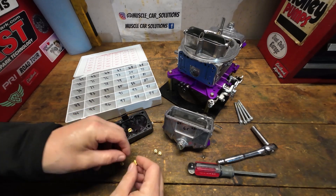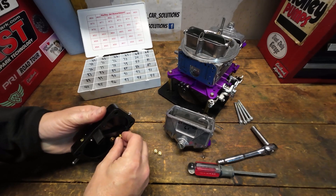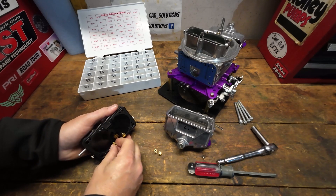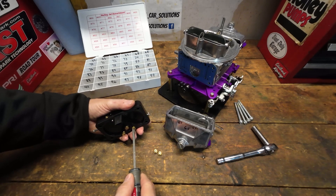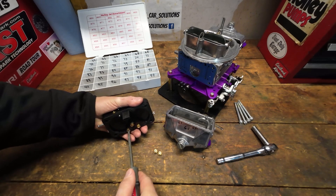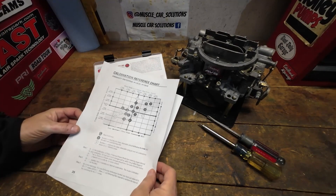You have to consider everything downstream — what's it doing to the spark plugs, what's it doing to the oil? Fuel and oil are not compatible; fuel will destroy the additive package in oil very quickly. You've got to make sure you're not running too rich, especially in an environment where you're not changing oil frequently. Now, if it's a drag car and you're running rich intentionally — on a staged nitrous system, or naturally aspirated just making sure you don't run out of fuel at the top end — that's fine, but on those cars you're changing oil very frequently. On a street car, you're not, so don't make those big steps.